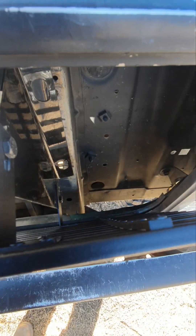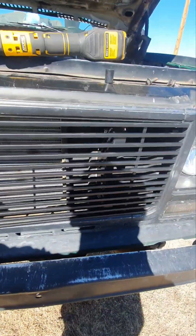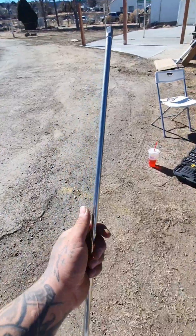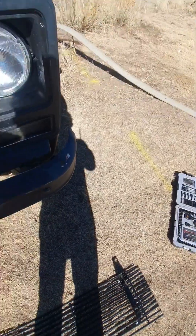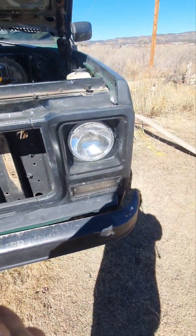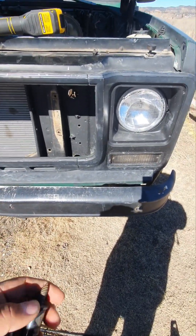So I'm just going to stick my extension through here. Obviously have it out, stick the extension through, and then put the socket on the other side because it won't fit through here. I think it's an 11. I'm just going to push it in there, tighten it up, and then pull the extension back so the socket will fall through to the ground and I'll be able to get it out. I know this is a pretty dramatic extension but you can use any one you have — a normal decent size one would work, probably a foot or even smaller.